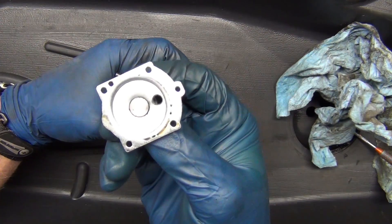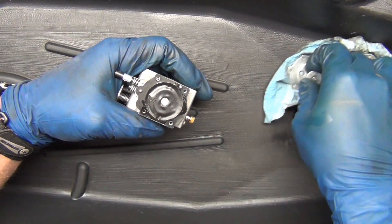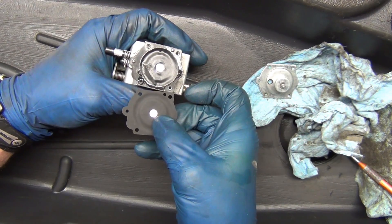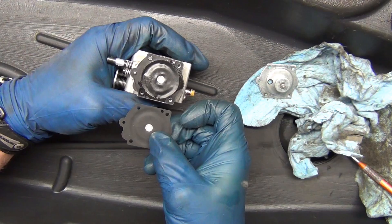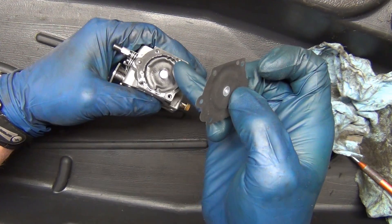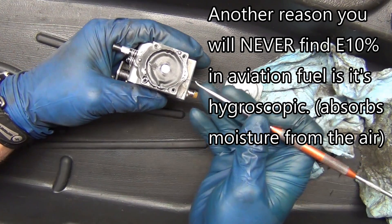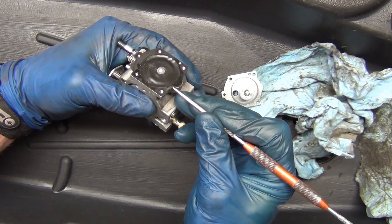What I want to show you is all the grit that gets in there — obviously it's exposed, there's a hole, so that's one problem. Look at the new diaphragm versus the old one. Can you see how this one's just worn out? It's full of grit and garbage, and the other problem is look how floppy it is. Ethanol gas basically eats carburetor parts — stuff like this it just makes go really floppy and you lose performance.